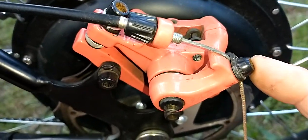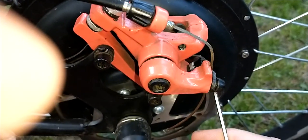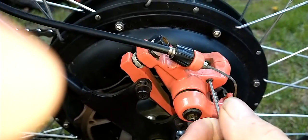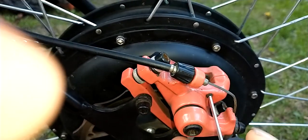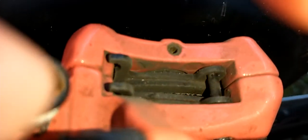You have to take off your release — the cable pull — and then you'll be able to lift the pad straight out of there. Now that I've released the cable pull using the appropriately sized Allen key, just remove this pin which goes through the two hoops on this style of pad.